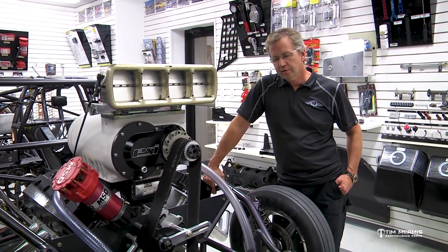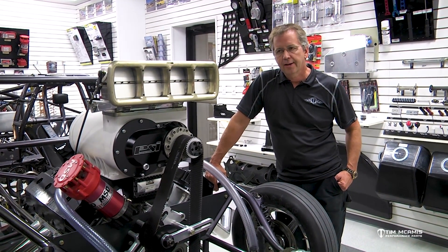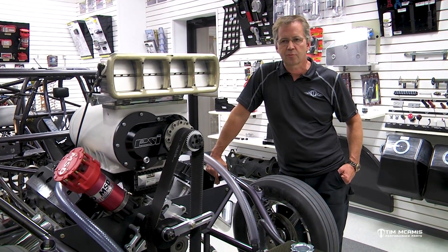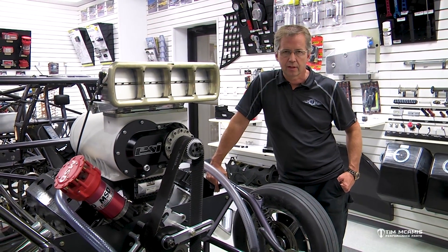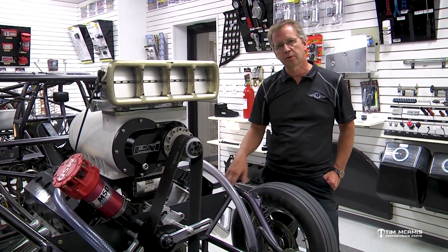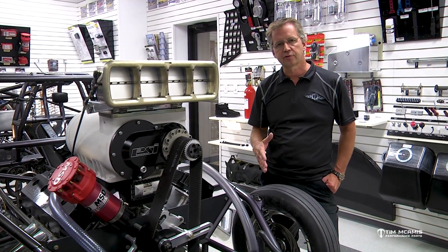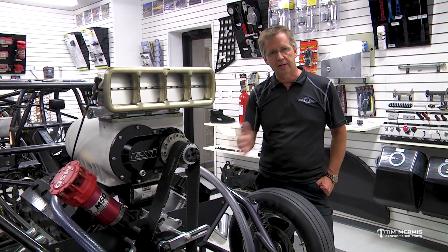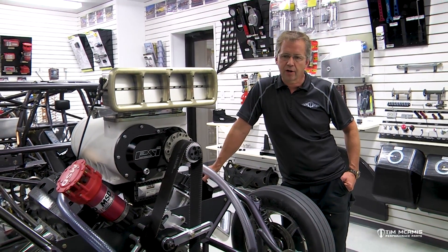So you get some guys arguing that in an impact, mild steel is much better. And to a certain extent that is correct, because mild steel is so much softer than a chromoly tube — it will actually bend and give. Where a lot of times, if you have a 4130 chassis and you take a glancing blow off the guardrail and hit the right front or left front corner, it will actually fracture some tubes, might even break some off, where mild steel will just bend and kind of roll out of the way. So in that instance, that is a valid argument.